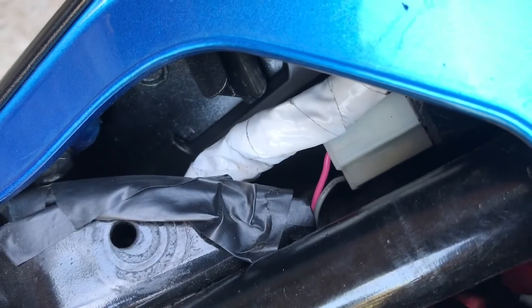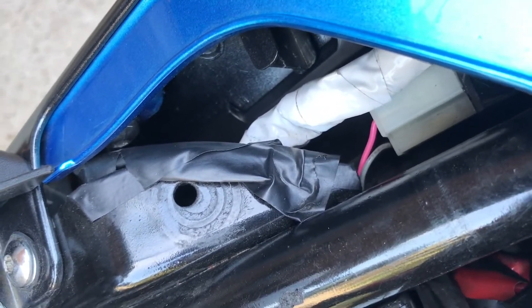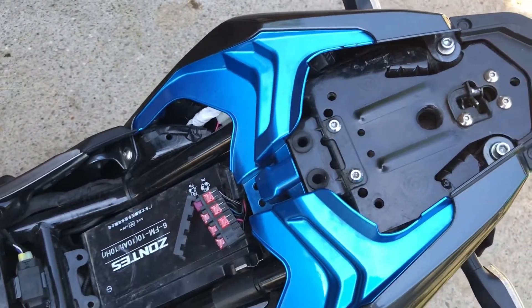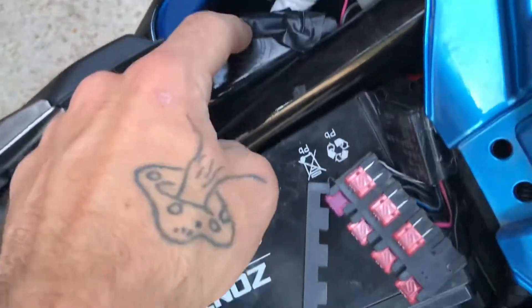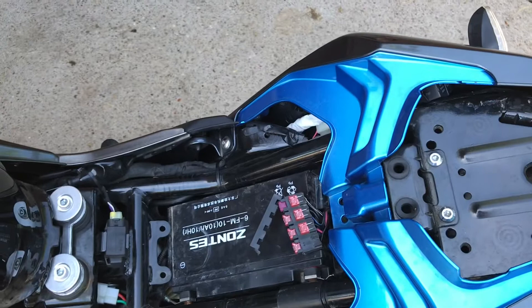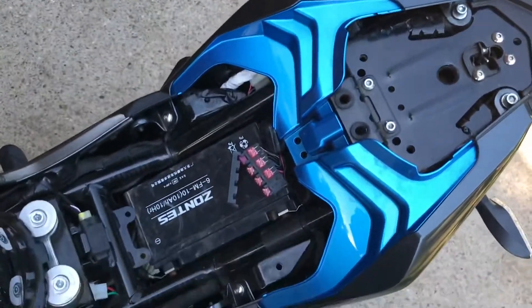Two or three of them were fully broke through, damaged and burnt, so I had to solder and rewire them. In the clip I filmed I just taped it to get me by, because I wasn't at my garage — but now I've soldered them all properly. Because some cables were broken, it left the cable a bit short, so I had to bridge the gap with extra cable. I'd put a bit of rubber around the edge of the frame there and taped it with electrical tape. If I were you, I'd cut the cable tie that goes around there and restricts it to the frame — it's not going to go anywhere with the plastics on anyway. You can see it's not rubbing on that bit at all anymore, but when it was there it literally ate through five of the wires.